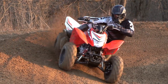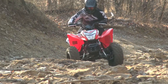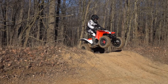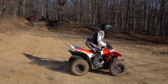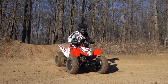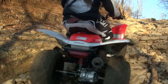Although the front shock's firm settings undoubtedly help keep body roll in check, traversing small bumps and ripples in the trail, the suspension's action was a little firmer than we'd like, regardless of each rider's size. Smaller tabletops were fun to jump, but Rob's 205-pound mass bottomed both ends hard from a flat landing a couple feet of air. Overall, the rear end seems a bit plusher and bottoms less. Ethan's antics never bottomed the suspension hard; however, by the time he starts going as big as Rob, he too will be overriding the limits of the suspension. We don't expect a beginner machine to handle big air, but we believe the 250X could benefit from a slightly more forgiving ride over typical trail imperfections.